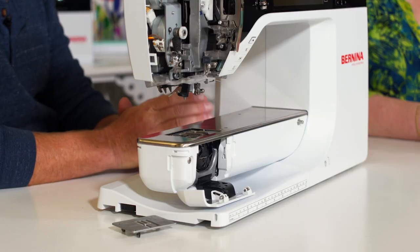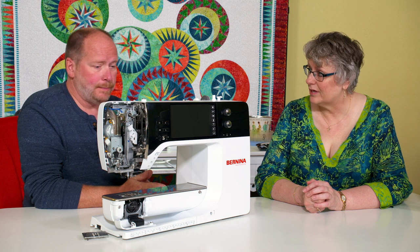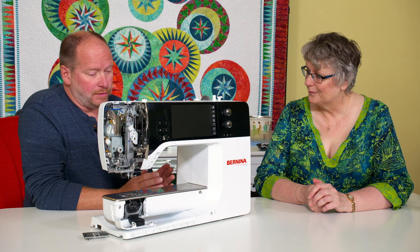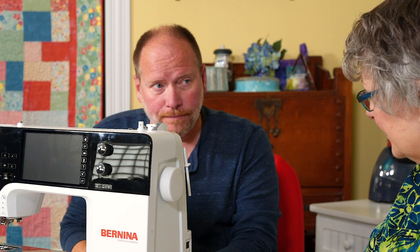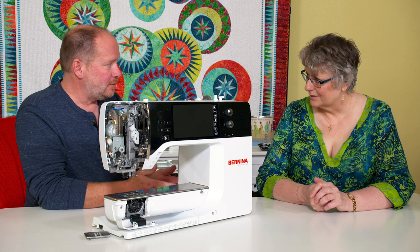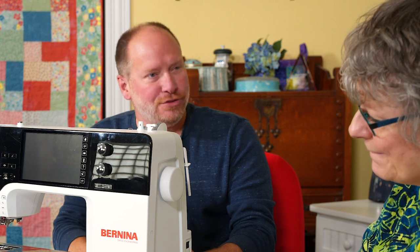How about oiling? Figure out what your machine takes and do not vary from that. Use what's only recommended by the manufacturer. If you're on Facebook and you see some chat group that says use another brand, you don't want to do it. There are different viscosities, different thicknesses. I used to do a particular thing in class where I would use the wrong oil and then look at how the machine stitches. Then I would clean that out and put the proper oil in. And you could plainly see both the stitches side by side — one is looping, not stitching correctly, and then with the proper oiling it all straightens out.